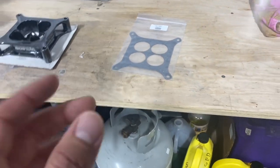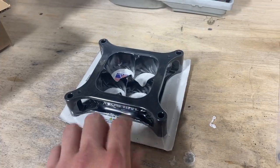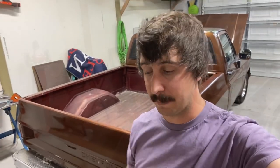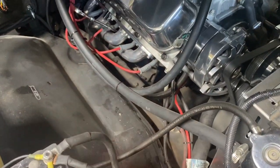But I like to do things a little bit better here and potentially address another issue I'm having. That's why we are going to talk about this Wilson four-hole tapered one and a half inch tall spacer. If you watch shows like Engine Masters or read articles online, you may learn that in some instances engines would like more plenum volume, and an easy way to do that is to add a throttle body spacer to space up the bottom of your throttle body from the top of the intake. This spacer has a machined portion which is supposed to help direct airflow down into the engine. One of the issues I'm having on my truck is I'm noticing different air fuel readings on each side of the engine.